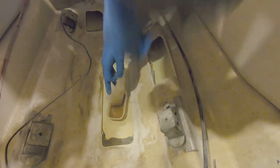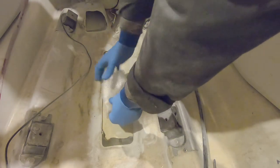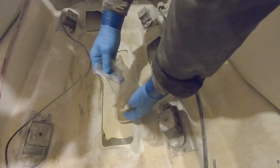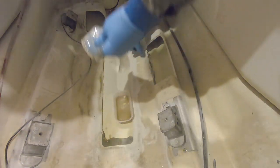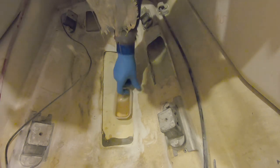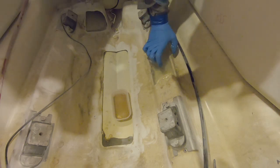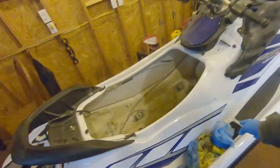This is a very messy part. I need to get the liquid all over my cloth piece — give it a good dunk and make sure it's fully permeated. You can really tell when it's fully permeated because it kind of changes to a different color. I like to put a little bit of resin on the edges of the hole to make sure it really sticks when I lay the cloth on.